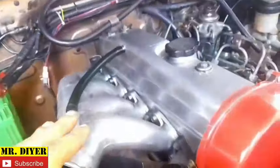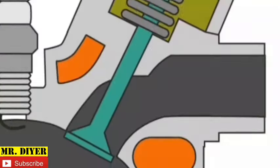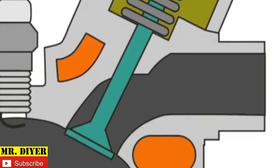The downside is your intake will end up looking dirty. And not only that, it also has the tendency to accumulate on your valves, causing carbon build-up. And if that carbon build-up becomes excessive, it might interfere with the opening and closing of the valve.